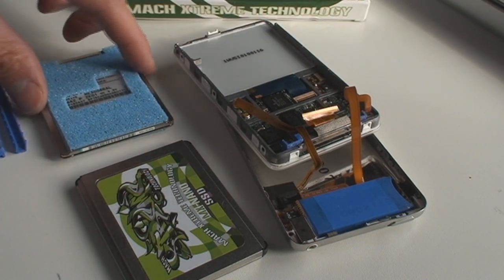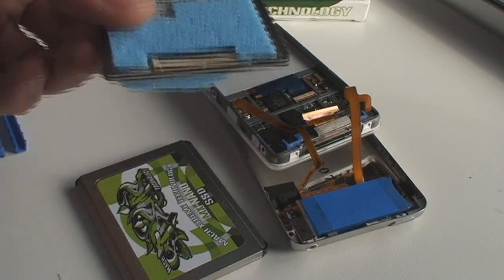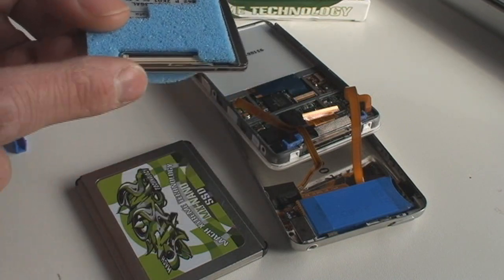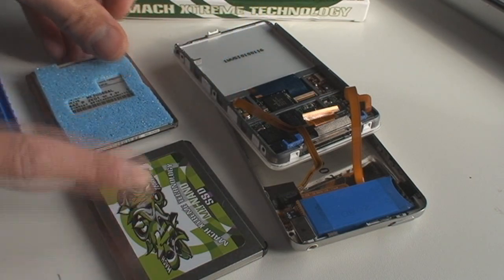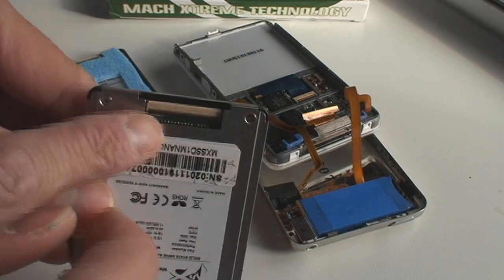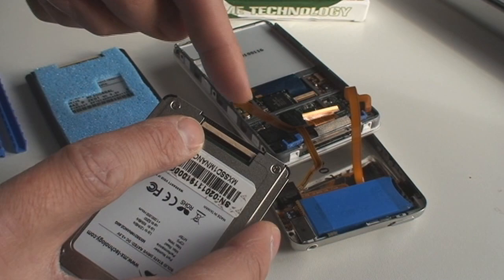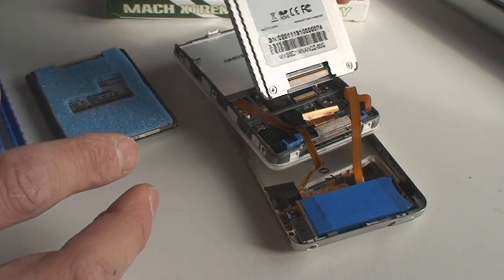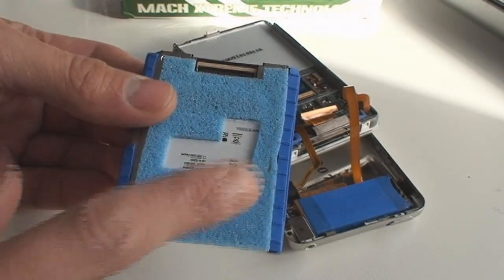Remembering how the connections are — which aren't too many — and replacing the foam padding. I took off the foam padding that was on there, looked at the connection, the way it was connected, and matched it up with the new SSD drive, which has the exact same connection. It's not rocket science, you just have to be very careful. Pay attention when you open it up, make sure that things are aligned, and it was very simple to replace.